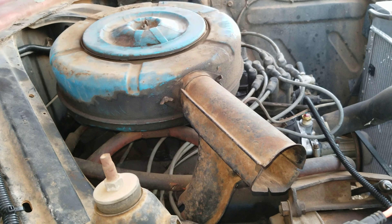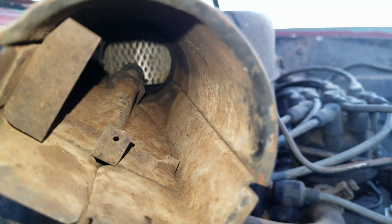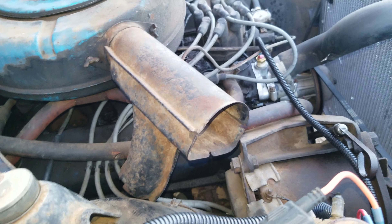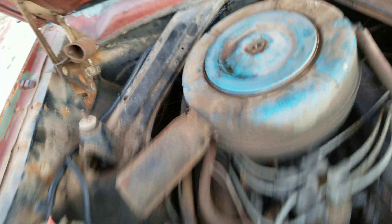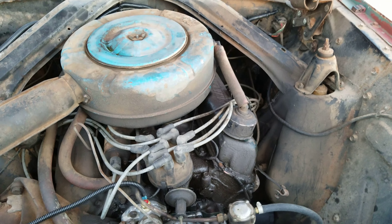This does have the original two-barrel carburetor and the original air cleaner top, although I did modify that door in there to keep it from opening down into the exhaust manifold area. Since there's no pipe on it, I really don't want it sucking from the exhaust manifold all the time, so I just blocked it off so it always pulls from the front. Eventually I'll put a chrome air cleaner on it, but for now this is plenty of air — it's not really a performance motor.